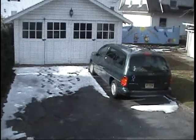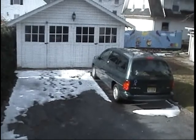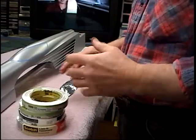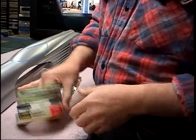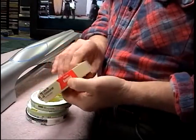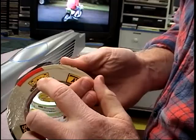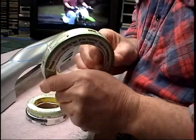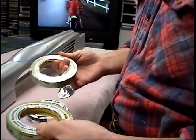We're not going to spray it until we get a little bit better weather, but I'd like to get a little test done today maybe. I was out yesterday and I stopped at the body shop supply and bought one roll of every brand of tape he had in stock. This is what they call general masking tape, and on each 3M tape anyway it lists the tackiness. This tape has some uses in doing a trim job. The stuff we like to use when doing a final tape edge is the green tape, which is certainly tackier than the blue.